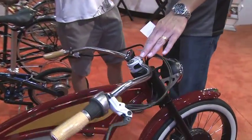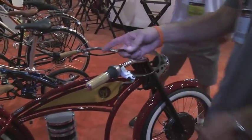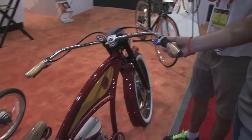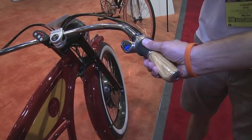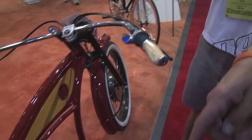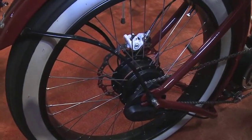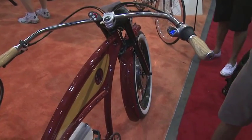Can you show us the shifter? Sure. This is actually the auto-shifting system called Harmony. The back of the hub has a computer and a shift motor. Harmony manages your pedal cadence — you set how fast you want to pedal, and it reads the speed of the hub through a sensor to know the speed of the vehicle. It then shifts automatically and seamlessly for you. That's our auto-shifting system called NuVinci Harmony, and it works with the N360 transmission. We also have a manual cable shift system as well.